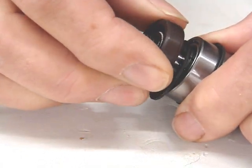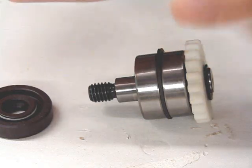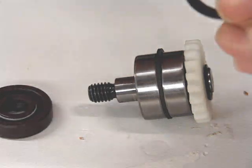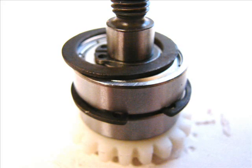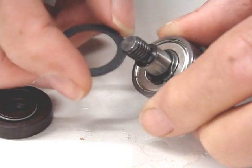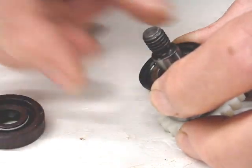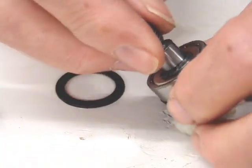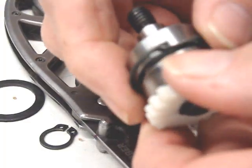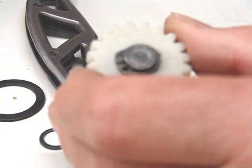We take apart the pump, take off the seal. There's a spacer washer in here which is sometimes a little tight — what I do is just run it around the belt sander once or take a file. It's only about a quarter of a millimeter too big in some cases. The reason it sits here is because of this little circlip. What this does is space the seal so the seal edge doesn't get nicked by this spinning circlip. Between the two bearings is another circlip that sits in the engine case in a groove — that separates the bearings and keeps the whole pump centered in the case.